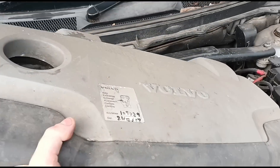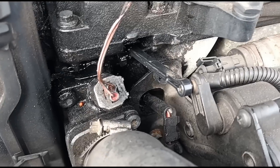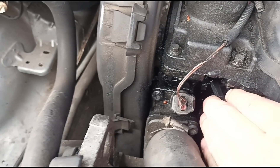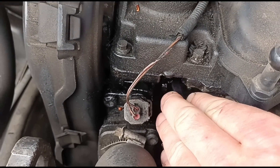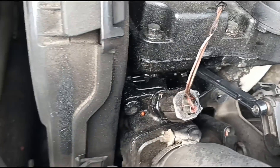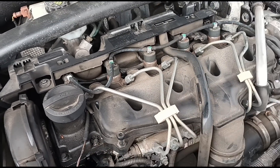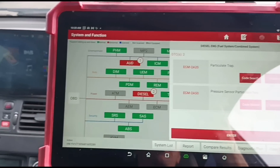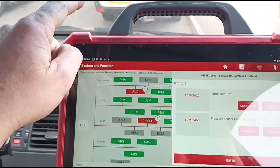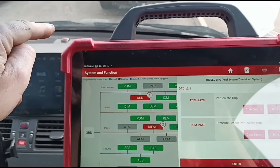Lift off the cover. Straight away I can see down here he's put a new arm on the actuator flap. But you can see there's a little bit of movement in the arm and there's leakage coming from there, so I think it's probably going to need that repair still. It needs more than just the replacement arm — it's going to need the swirl flaps doing.